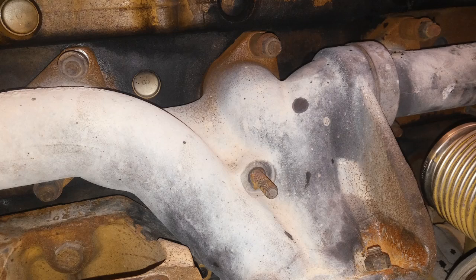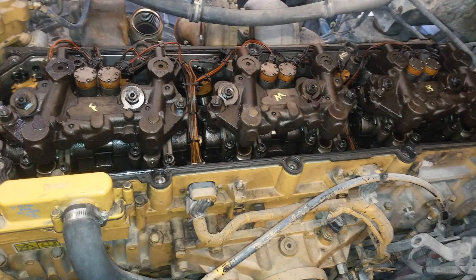While you're disassembling, always look for missing components or damaged components, because many of these will get reused, like the exhaust manifold. Notice that it's missing a nut on one of the studs. This could lead to, possibly, a cracked exhaust manifold, something like that.